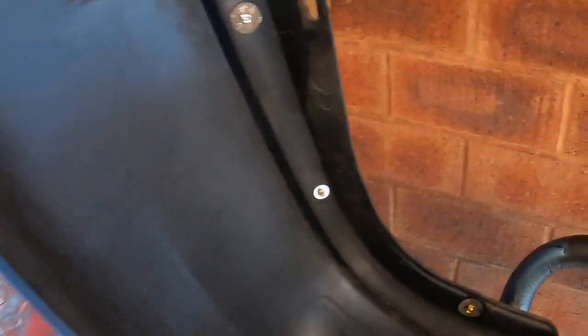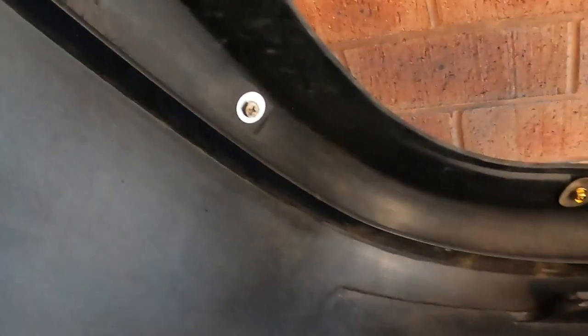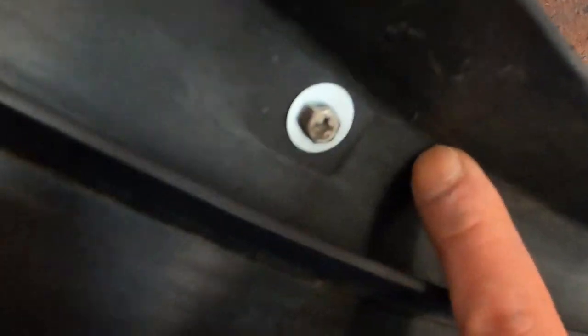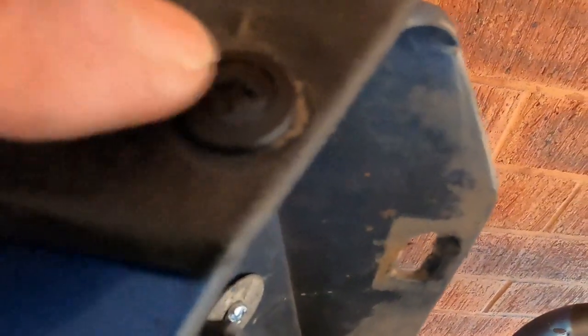There you have it — this is from the inside. Gotta love those Japanese cars. The screw is supposed to go in here, and if you look carefully you'll see there's a groove or a mark — as if this bumper, by default, has the spot where you need to drill to put this spoiler lip. So I've got one over here, another one, another one, and from the outside I use the trim clip. Similarly on the other side — one, two, three, and the clip.